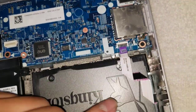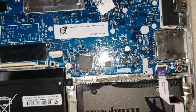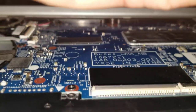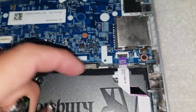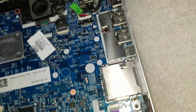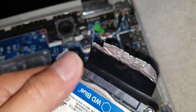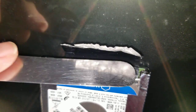These ports are all soldered to the board. I replaced the hard drive with an SSD, so it's pretty simple. The actual hard drive will have the adapter on it — the adapter converts the SATA to this little connector here, and this tape just wraps over it. You'll have to peel this tape back and make sure not to bend this cable too much, then separate it from the tape and pull it out. The connector was difficult to remove, so I used a pry tool and put it between the two layers and pried it up — it came out pretty easily. I just did that on both sides.